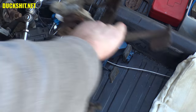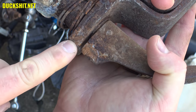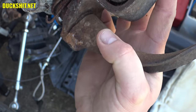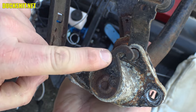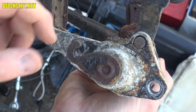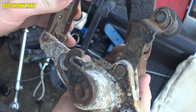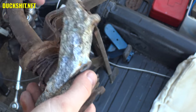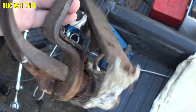The pedal assembly from the back side has a section where the stop comes into contact. If the stop is too far down or missing, the pedal falls because nothing stops it. A second problem: if the pedal falls down, the clutch cable hook is no longer doing its job and the cable can pop right off. I recommend tying the cable down with a little bailing wire before assembly — it helps if that situation occurs and also helps with general pedal cluster assembly. This particular unit needs serious restoration. All the parts seem to be here except the brake push rod, even the springs. A good disassembly, sandblasting, and coat of paint would do wonders, but it doesn't involve this project so it'll be set aside for now.